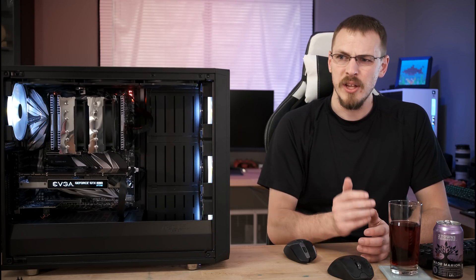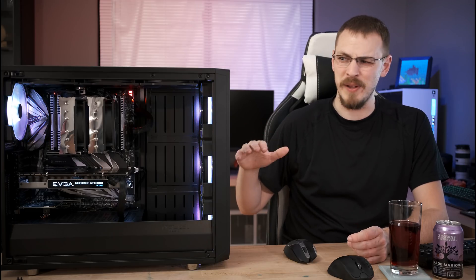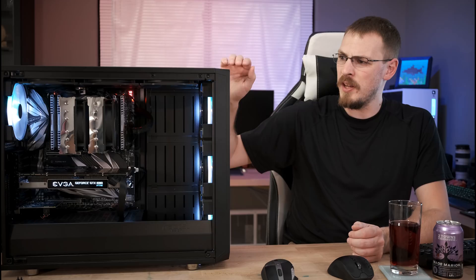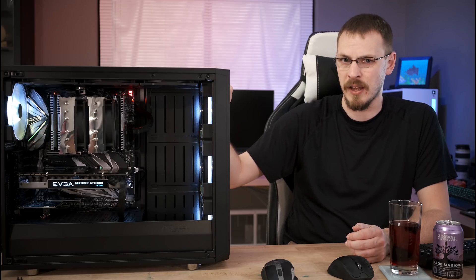I think I'm going to call that a pretty successful test. Just delidding — not using liquid metal or anything really exotic, just Arctic Silver 5 — yielded about a 14 degree delta between our previous values at 4.3 gigahertz and our new values. I'm pretty happy with the performance here. That takes this machine at 4.3 gigahertz to borderline usable — I could totally rock this all day long with this Scythe Fuma Revision B. You might be seeing some more videos with this machine coming up in the near future. I do plan on using this as a new streaming PC long term, so it'll actually be living down here on the floor right next to me. What do you guys think of the build overall, and do you think the results are adequate for what I'm going to be using it for? Let me know down in the comments below. Make sure to like this video if you liked it, subscribe to Craft Computing if you haven't done so already, follow me on Twitter at Craft Computing, and check out the Amazon affiliate links in the description. As always, thank you so much for watching and I will see you in the next video. Cheers!